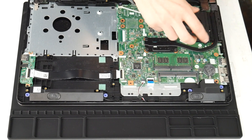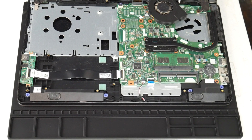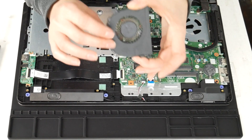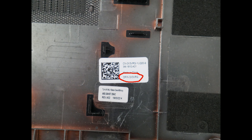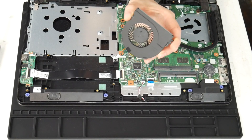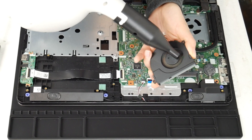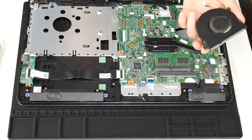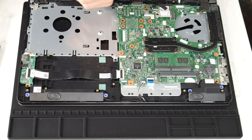I've examined and cleaned the whole board. Now I'm taking the fan off. I'm going to use a high-pressure air cannon — you could also use a hair dryer or a can of compressed air; I've included links for both. This is what your fan looks like. If it's still loud, I'm also showing what a replacement Dell fan part number looks like, in case cleaning isn't enough and you need to order a new one. I take the cannon and give it a good run through to clean out any debris.